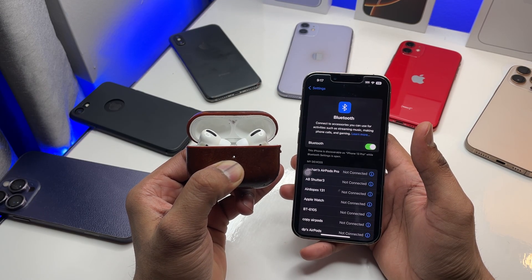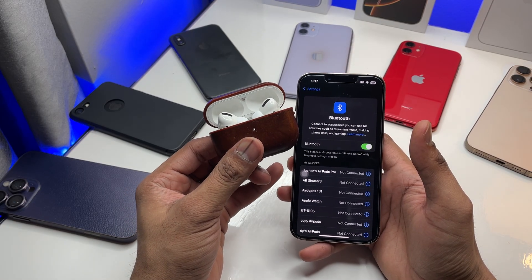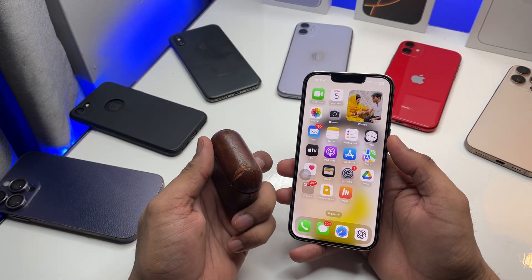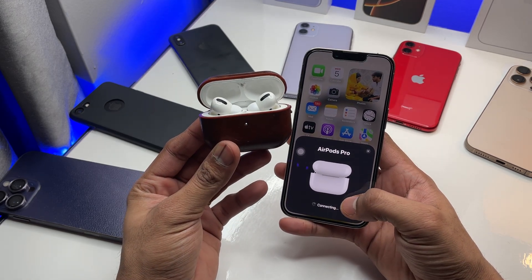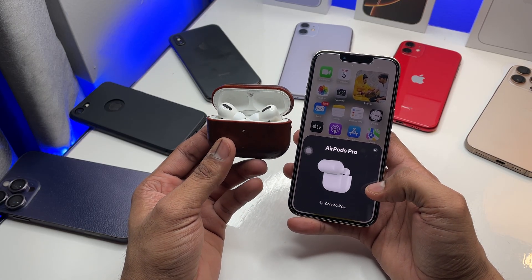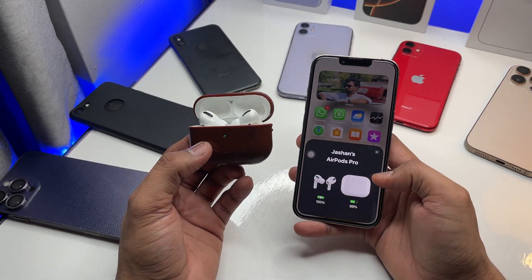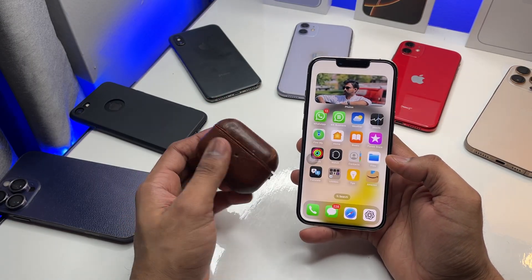After the red light, wait for the white light — there you go. Your AirPods are now in pairing mode and have been hard reset. Now shut the case, then open it again and you will see the AirPods Pro have been reset. Connect them — they are connecting. It will say 'Hey Siri' and your AirPods will be successfully connected and working fine.